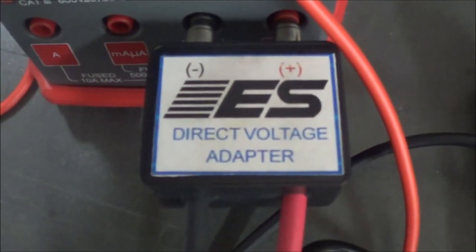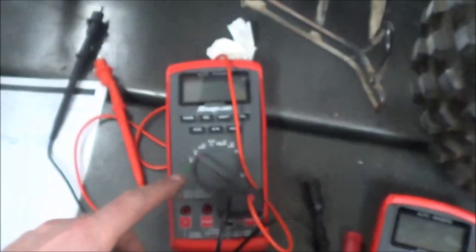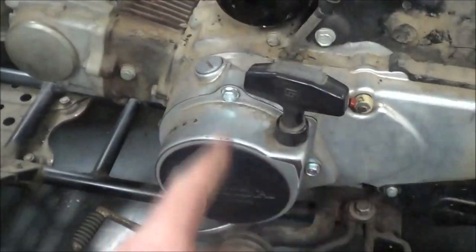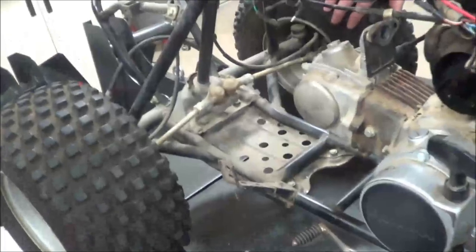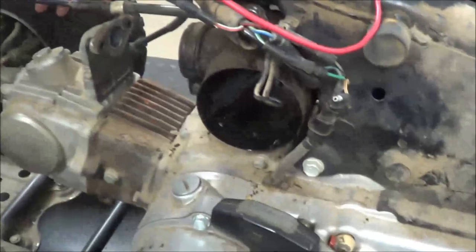We have another tool here — a direct voltage adapter for our multimeter. This is one of your best ignition testing tools. What it allows us to do is use an everyday multimeter to basically dyno-test that coil. As we pull-start and spin the motor, we can read the amount of voltage coming out of that coil. You could actually see it go up and down due to the rotation of the AC signal. The manual doesn't have a spec for that, but we had consistent voltage coming out, so we felt we could keep moving forward.